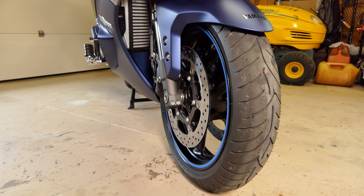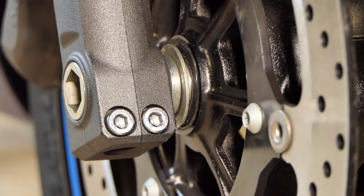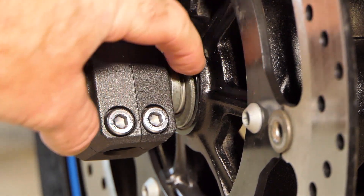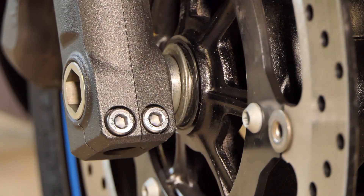I was walking around the front of this bike and I just happened to look down at this axle, and there's a washer in here that was crooked — that didn't look right. This is the axle on the right side of the front wheel. This washer is loose in here, just sitting on the axle. That ain't supposed to be that way. Parts don't just get thrown in there to sit around — they're supposed to be doing something. So we'll have to pull this axle and front wheel out to figure out where that washer is supposed to go and make sure the rest of it's put together right. Look your rigs over — your life may depend on it.